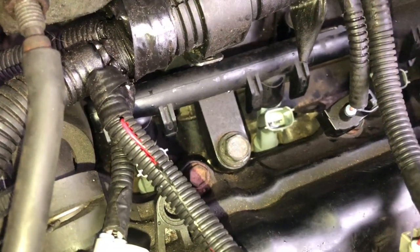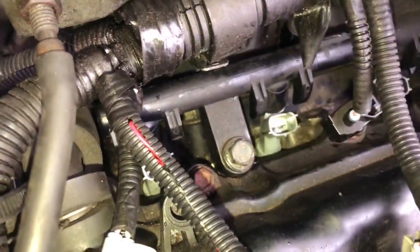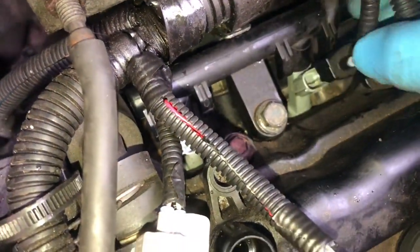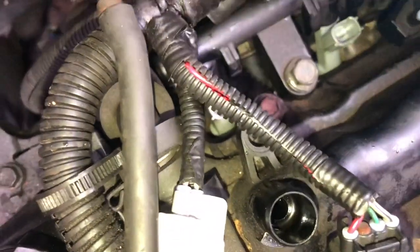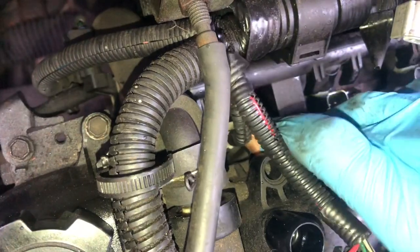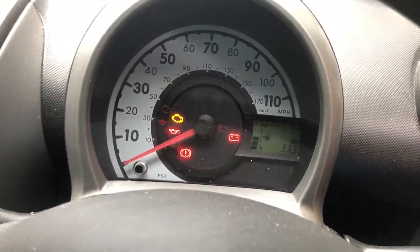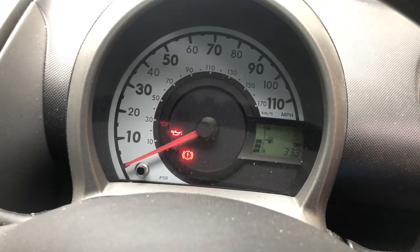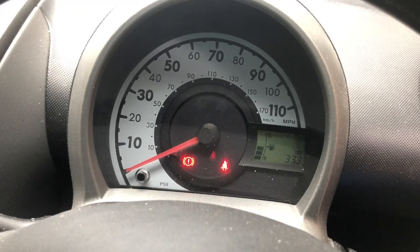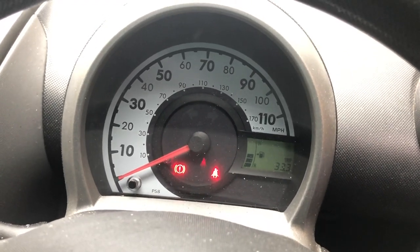We just nip that up. These we just plug back in. First we'll put this back on — if you remember, we took this off — let's put that back into place. There's one injector, two injectors, and then there's another one. Right, now let's put the filter back on. No leaks, really. So let's start it. That took a bit — we've just had to refill the fuel lines. And it seems to be running all right, actually.